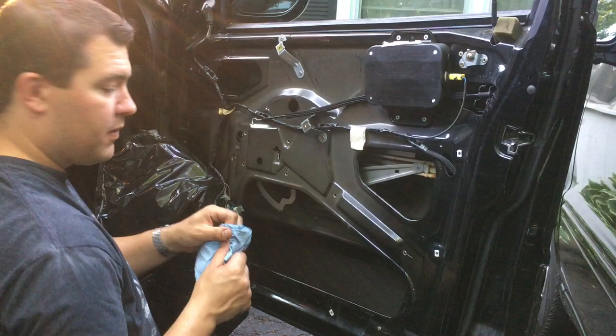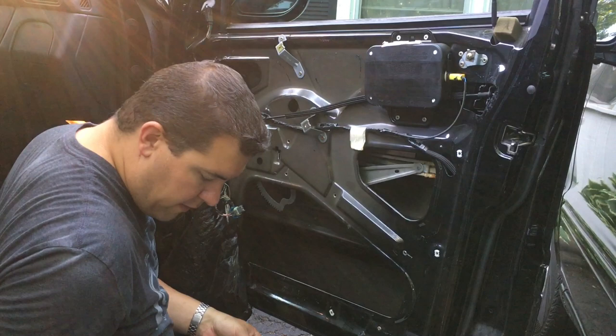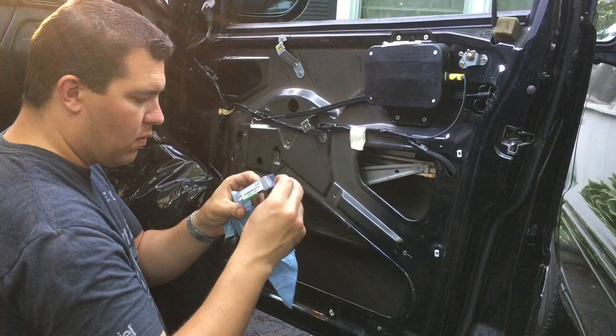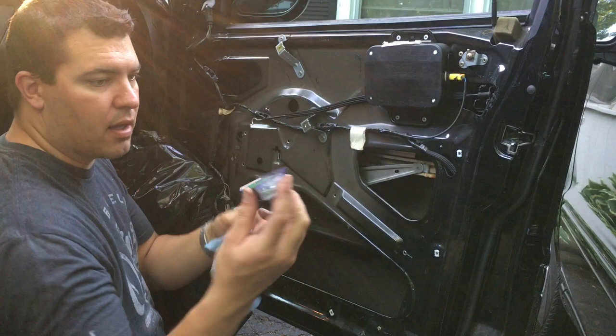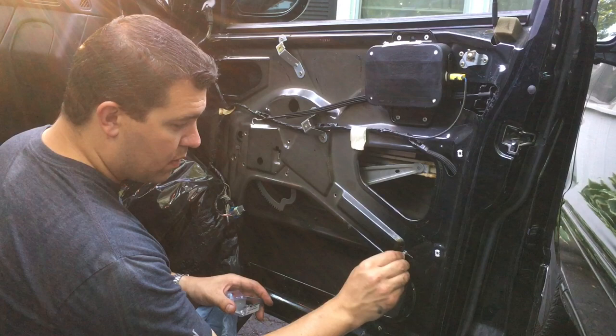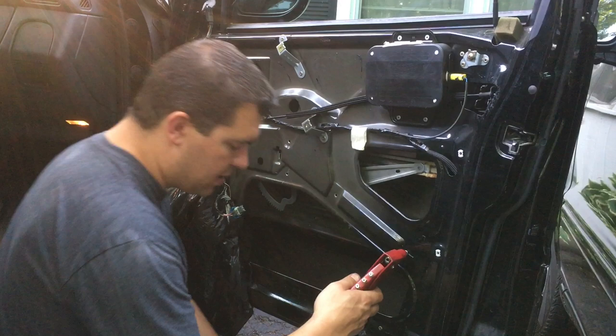You gotta take some rivets, and those are too big. I think these are the ones I use. They're 3/16 by 1/4 inch. The part number is 231-8114, so if you can see that or not. So I'm gonna take one. One's gonna go right there. You're gonna rivet it in, super easy. You can buy one of these riveting tools at the store for like, I don't know, 30 bucks. All right, there's one.